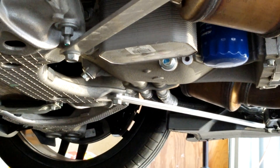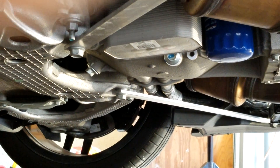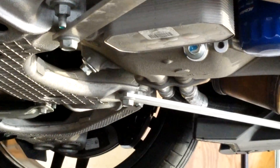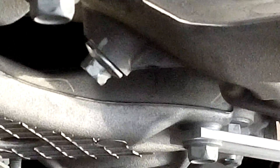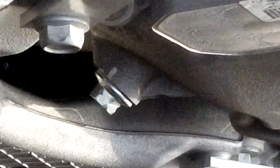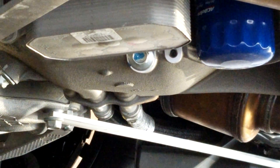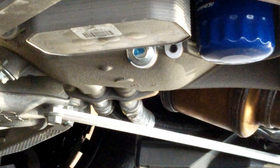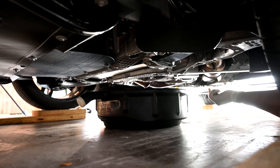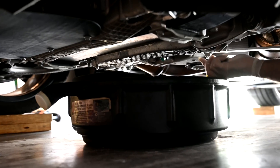As you look under the car, you can see the blue oil filter there on the right, and then there are two nuts you have to undo — these oil plugs. The one on the left is facing forward, and the other one is just to the left of the oil filter. Those two nuts need to be loosened to drain the oil. There's the oil pan underneath, and as we zoom in to the plug, you can see it takes a 15-millimeter wrench.